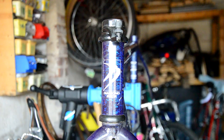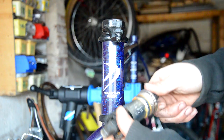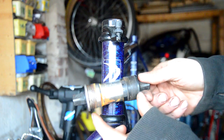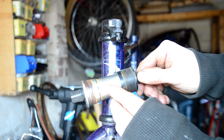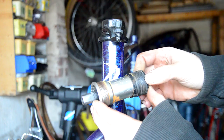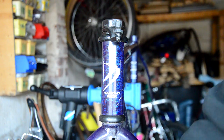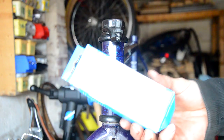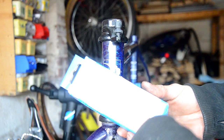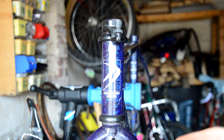Okay, so thanks to the local shop, Two Wheels Only, hashtag not sponsored. This is the old one. It's a BBLP30, which you recognise straight away was an old bottom bracket. It's a 73mm shell with 119mm axle, and they had in stock a UN55, which is the standard now, 73mm, 118mm axle. So that should work.